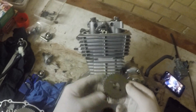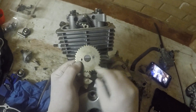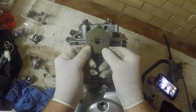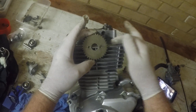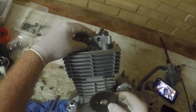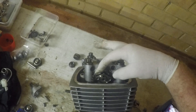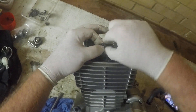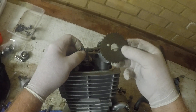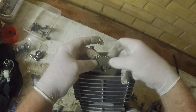The other mark of interest is on the cam sprocket itself. You'll see there are two marks, one on each side, and those marks must line up so that they are flat with the gasket face of the cylinder head — the rocker cover gasket. The camshaft itself has two bolt holes and a keyway, so if it's pointing straight up that's your timing. When you align the marks on the sprocket it will automatically put the bolt holes in the right place.